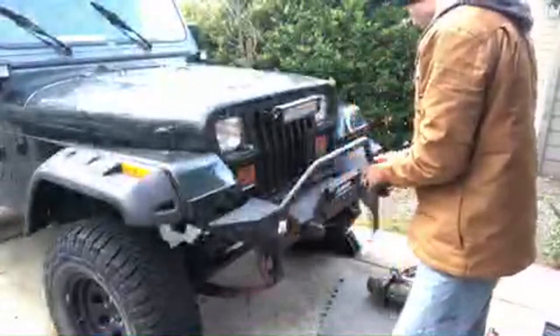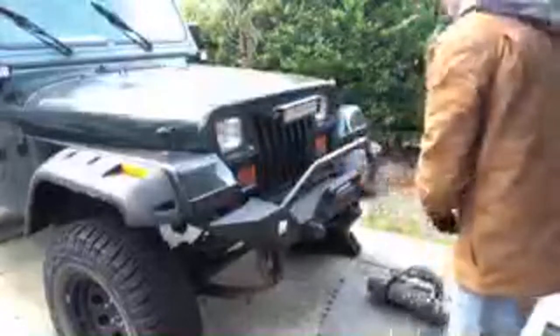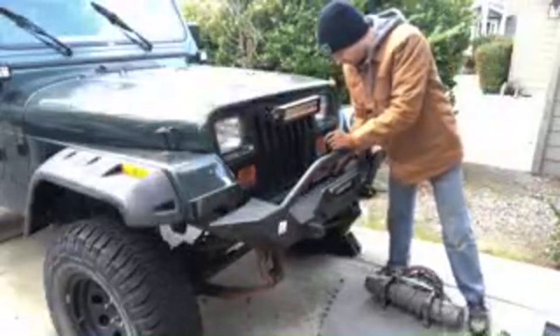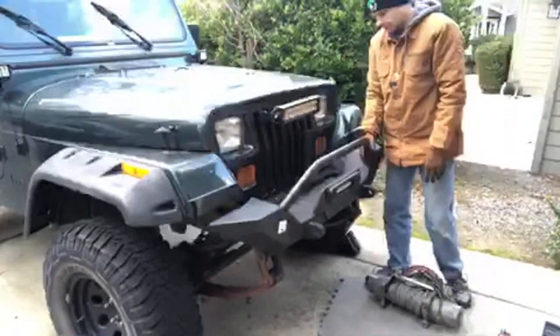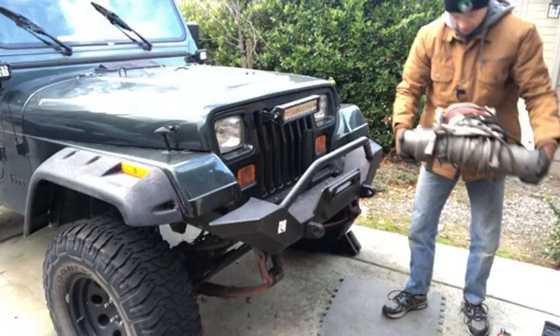It's not a 10,000-pound winch, and I'm certainly not pulling with that. I would only use it to give me a little nudge if I needed, like 500 pounds of force, just to help slide me out of something. But I certainly wasn't ever pulling hard with it, and I was always ready for the cable to snap. I took precautions. I've seen videos of cables snapping that are just horrible.